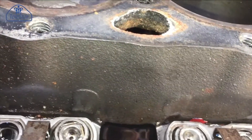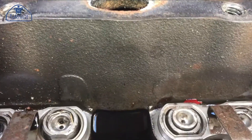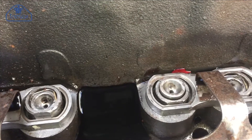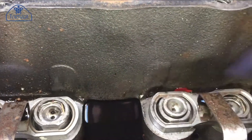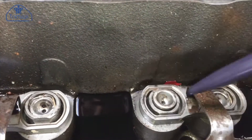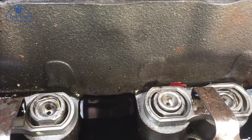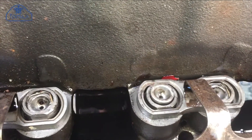Now, that wouldn't have been caused by water ingress. That's most likely to have been caused by when the valve train was very noisy, which was covered in an earlier video. It was because the preload wasn't adjusted correctly, hence why it was such a noisy valve train. So what that would mean is there would actually be a gap between the pushrod, and when it reaches the end of its travel that gap causes a jolting every time it comes back up again.